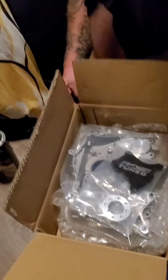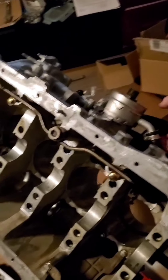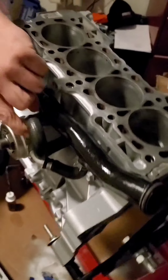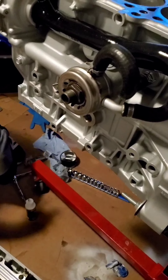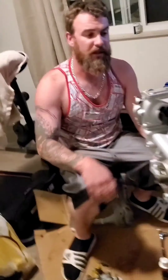After you shred some bearings and all the oil goes through everything in your motor, you're basically just replacing everything. Good that you hot-tanked it — the head and the block. When I took those lines off, the necks coming out of the oil cooler were completely filled with sludge. I had to dig it out with a flathead screwdriver. I think my engine oil ended up getting so hot that it ended up spinning both of the bearings, because the bearings were starting to seize from overheating.